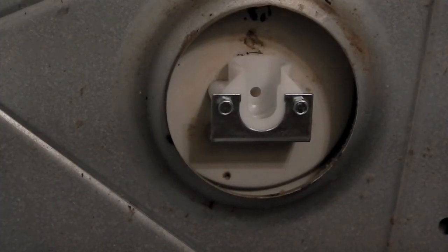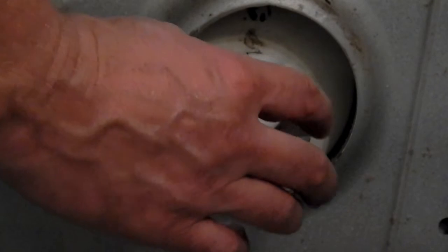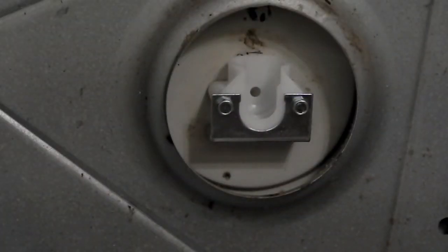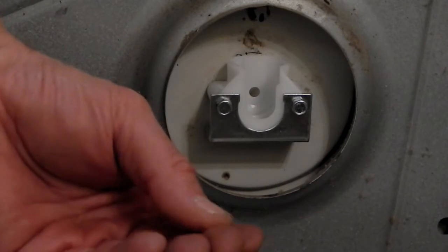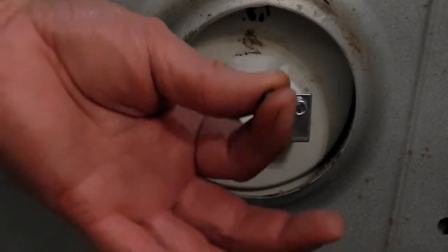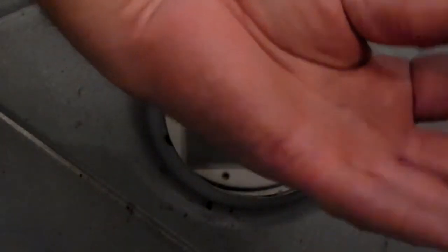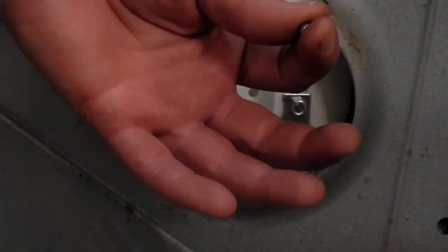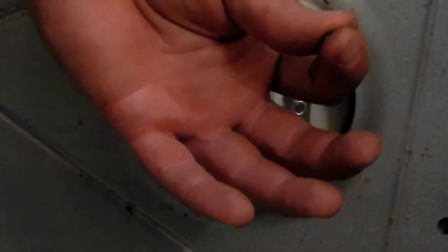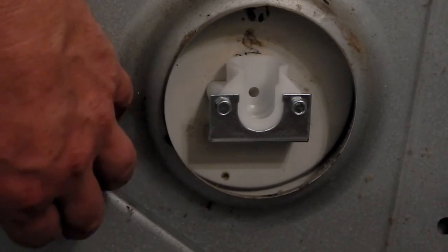Okay, so here's what the bearing bracket assembly looks like when installed from the inside. Should go in just like this, which is simple enough. The trick is, on the back side of this, in that little hole, is where this little ball goes, which, believe it or not, the purpose of this ball is to actually electrically ground the whole tumbler assembly, the drum, to the rest of the dryer. I'm assuming that if that wasn't grounded, then quite frankly, this thing would probably build up a huge static electric charge and turn this thing into a Van de Graaff generator of sorts.